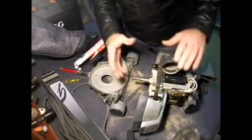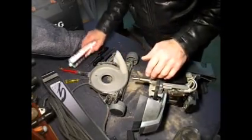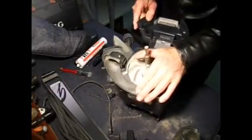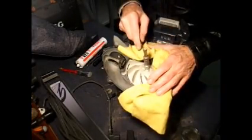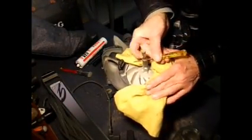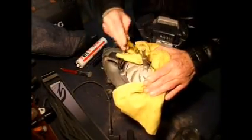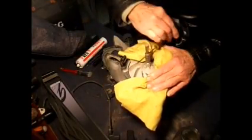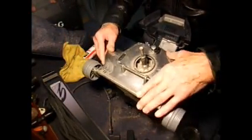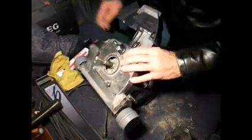Here we have our shoe back in there. I've cleaned up the faces on that side just a bit. There's the silicon sealant, which I haven't put on because I'm going to strip it down again. Now we'll start reassembling. The first thing is to tighten up our pulley fan — remember it's a left-hand thread, so we're turning it this way. I can feel the fan going down — it drops on just like that.